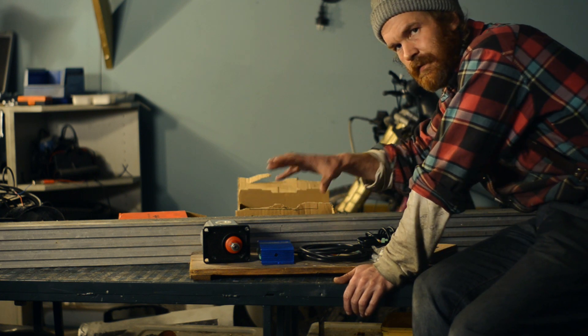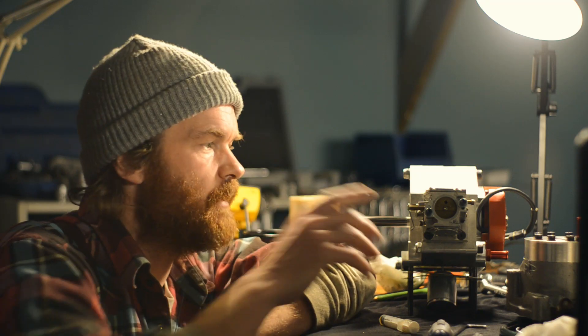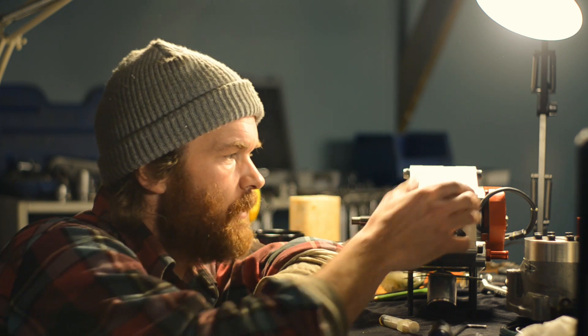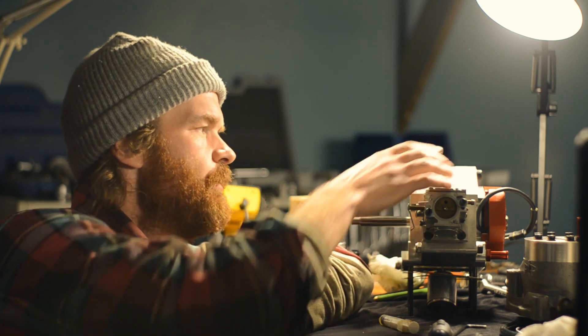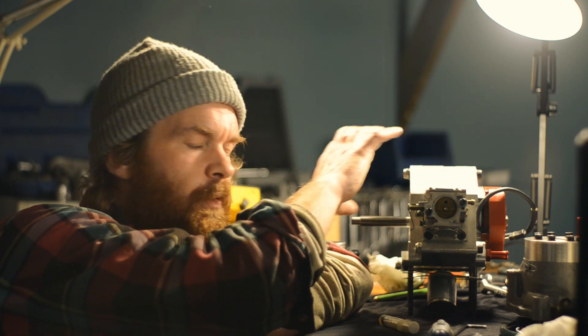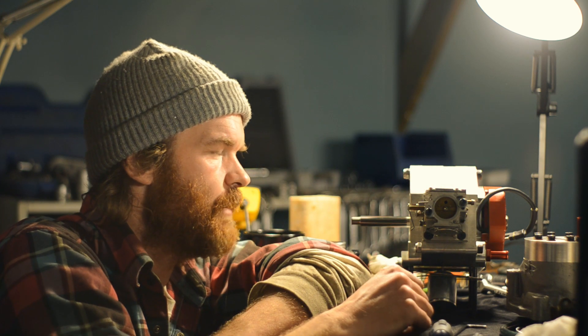I need this dyno to be able to test the secondary intake, because it needs to be under load - there's no point tuning an engine you can't put under load, especially when it's meant to stay at constant load and constant RPM, which this system will provide. That's why I'm building this instead of using the inertia dyno. We're testing it with the different reed valve and the pumper carb - mounting the engine upside down in the vice to avoid pooling of fuel in the crankcase.